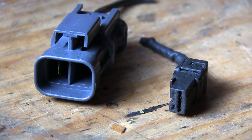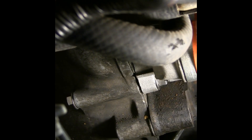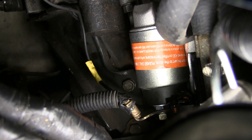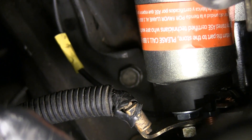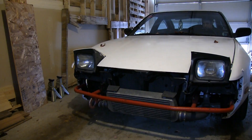Now that we have those two things resolved, we're ready to put the new starter in the car. Here you can see I've put the starter motor in with our longer bolt and nut. This little spot by the intake is also where I was able to reach down and insert the starter and get the bolt in the easiest — I tried it from underneath the car, but it was damn near impossible. Once you have the starter mounting bolts tightened up, you're ready to reconnect the ignition cable and the positive battery lead. Once these are tightened down, you can put your battery cables back on and test it out.